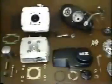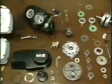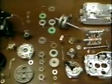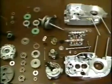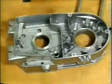Engine assembly. Prior to assembling the engine, make sure that all parts intended for reuse are absolutely clean and have been carefully examined for signs of damage. Tab washers, gaskets, and dismantled oil seals have to be replaced with new parts. A replacement crankcase has to be completed first.